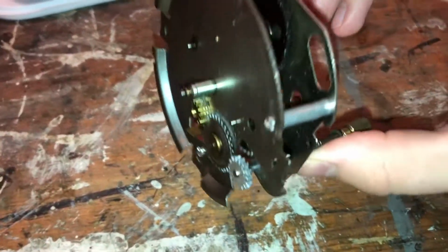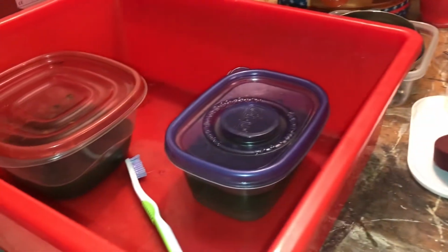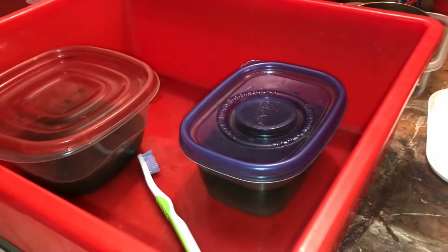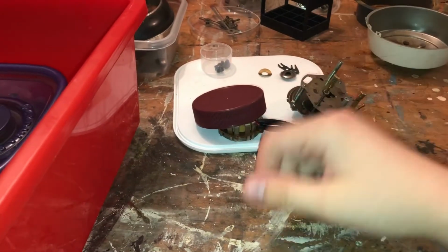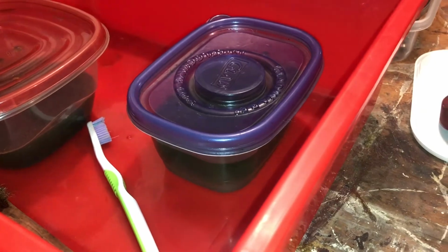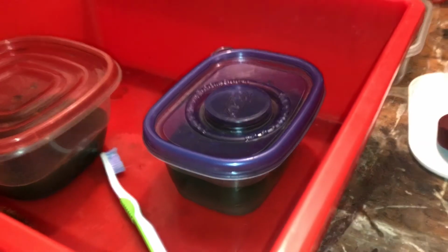Although, is this a gear I really want to screw up? Let's be serious here for a second. I know that the whole area isn't very busy right now because it's nighttime, and I won't be in here much tomorrow, so I'd rather not screw up a movement. I'm going to go grab a broken fiber gear, or one that has its teeth stripped out, from the garage, and try it in this alcohol here. I know simple green will be fine, but I don't know about alcohol.